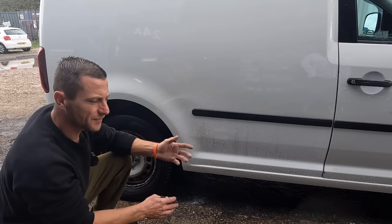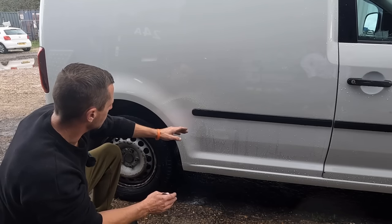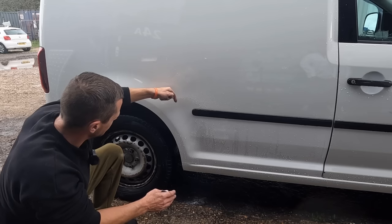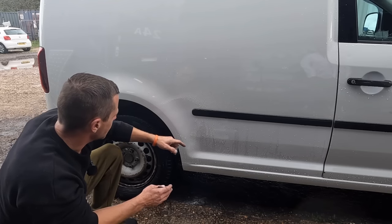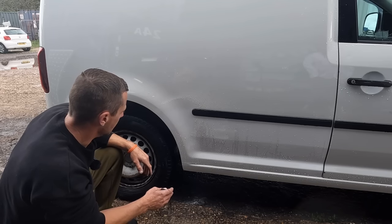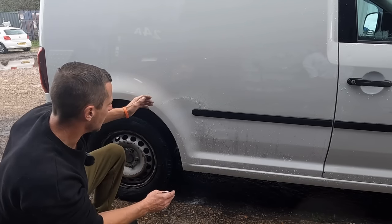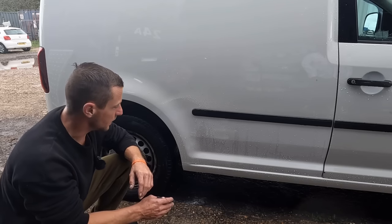And what a blend edge, or a fade out, sorry. What a fade out is, if you're trying to go from old paint to new paint and blend it in, you don't wanna paint up to your tape because you're gonna have a cliff edge. You sort of stop with the paint. Don't go right to the edge, you sort of come away and let the pressure off so the paint thins out on the end. It is a skosh whiter. I can't do anything about that, but if we do the wings, I'll probably add a bit of colour into the white and that will blend in the paint a bit better for the next paint we do.